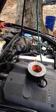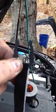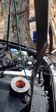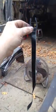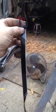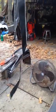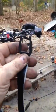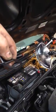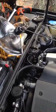Here's one of the tricks: this is the clip that holds the temp sensor in. Take a piece of gorilla tape and tape it on there. Take a long strip — you only need it about as wide as the back of the clip — make it double long, tape it together. This is going to help you keep a hold of it when you're down in there trying to stick it in the groove to lock in the thermostat.